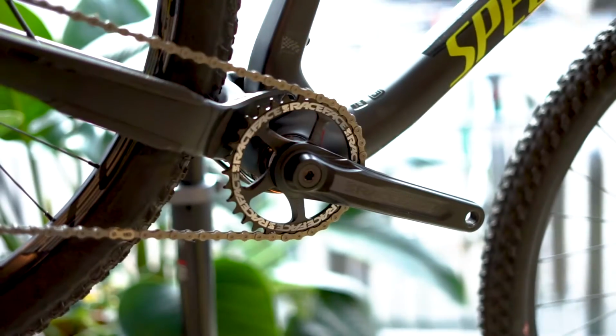Third tick is because the wheels are bigger, to get the same gearing, we need to change the ratios. So they've made the chain ring, which is the front crankset, smaller. The cog is smaller, which gives you a lot more log clearance and wears everything evenly. So now you've got smaller, stronger cogs with more clearance. So now you've got more crossover height over logs.